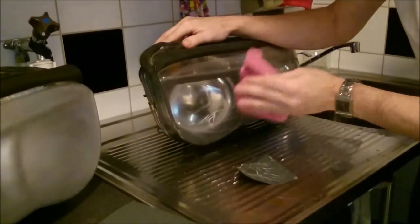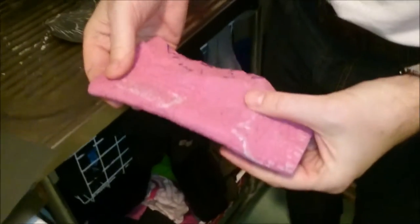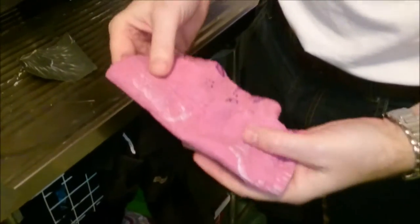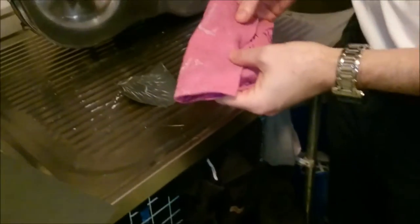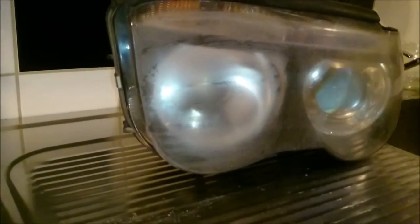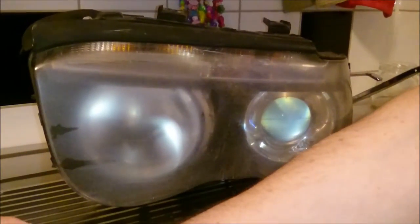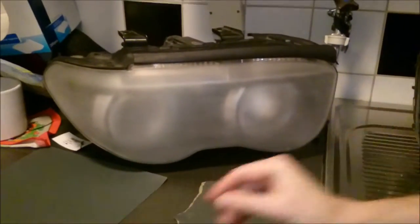I think it's time to change the paper. As you can see on the cloth, you can see the dirt — it's plastic and clear coat. Now you can see the very clear difference from here to here — it starts to get a nice shine to it, a dull shine, but this is what we want to achieve. After this is achieved, you will use the 1200 paper.